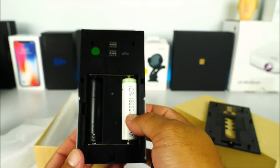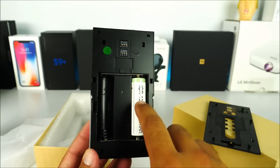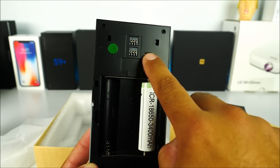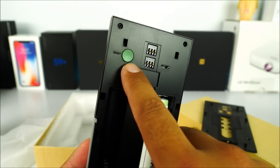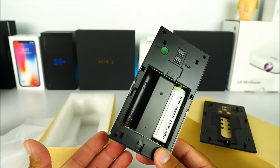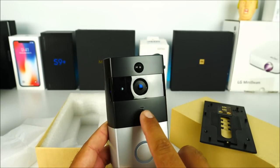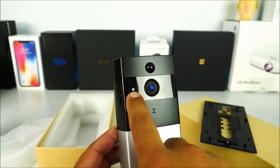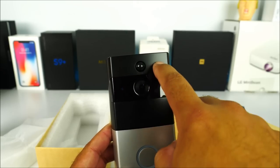I had to use the battery since I don't have an existing doorbell. The battery goes inside this back compartment — it's a little bit hard to open, but there we go. With only this one battery, I was able to get one month and five days of usage. To charge it, you remove the doorbell from the wall plate and connect a standard micro USB cable. It supports any smartphone charger. There's also a reset button — hold it for about 8 to 10 seconds and it'll forget all your setup.